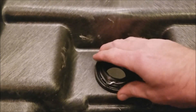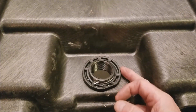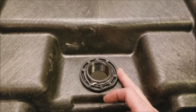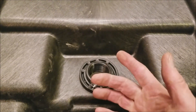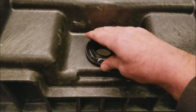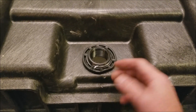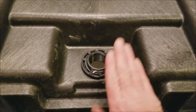Bulkhead is installed good and tight. I got the channel locks on here and tightened it up real good — actually tighter than it was when I brought it home from Tractor Supply. So maybe that's another reason these might leak for some folks: maybe they just aren't tightened up enough to get that gasket on the inside good and snug. On the inside it's nice and snug — I don't think we'll get any leaks out of that.